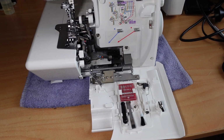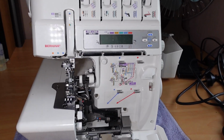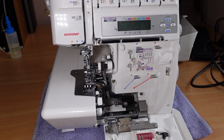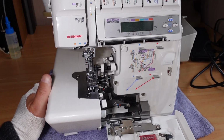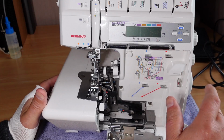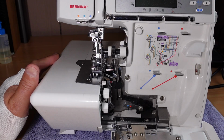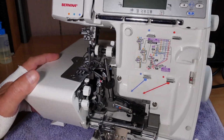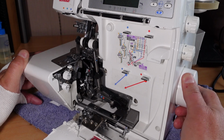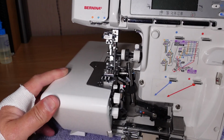So I've gone through troubleshooting a seized machine before in a previous video. Trying to remember which one it is. I'll link it in the description down below. But with a machine like this, they're reasonably complicated. Being a serger, there's a lot of moving parts. There are some quick procedures you can carry out to try and track down the seizure, and that is by turning the wheel, and what we're doing is we're looking for any movement, and what the movement does is it sort of eliminates that from the equation, if you like.